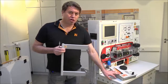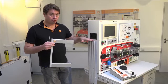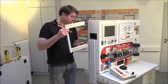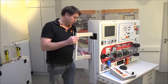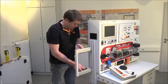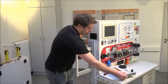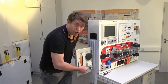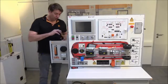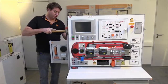If you have the optional charging station and holder, it's also easy to fit — that's why we left the plastic caps off the aluminum profile. You can put it on either side depending on your workshop or classroom arrangement. Slide the holder down to where you want it, tighten with the 4mm hex key, put the top of the charging station in first and let the bottom sit in place. Once all components are in place, put the black caps back on with a gentle tap.